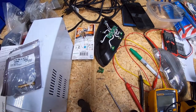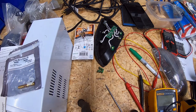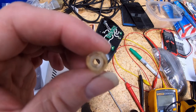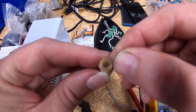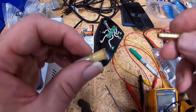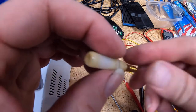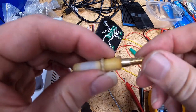Welcome back. I slowly went through the gambit of drill bits and walked it up to what ended up being a 15/64 inch bit, and as you can see it's a little bit wider on that end now. It made for some thin walls but it still has its integrity. The point was to go slow — drill in a little bit, reverse the drill, drill in a bit, reverse — so you weren't trying to do it all in one pass. Now we can take our barb and fit it in up to that flat spot we were looking for.